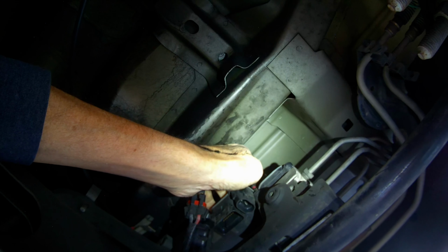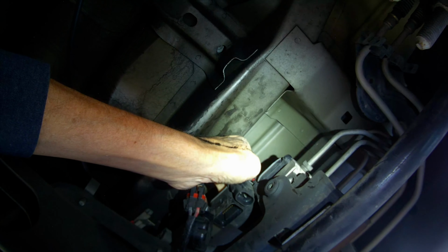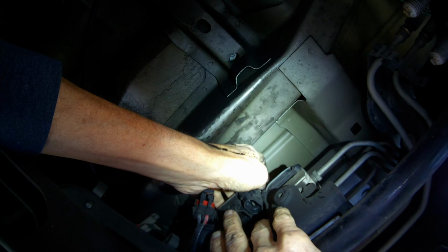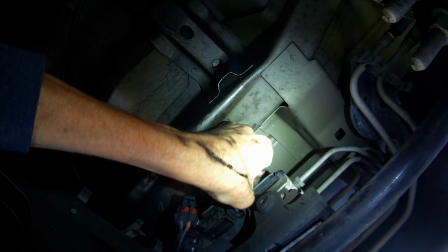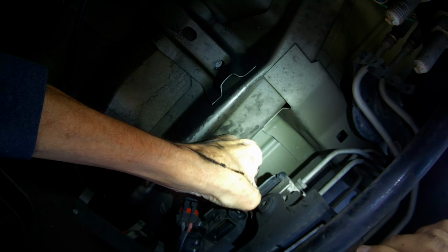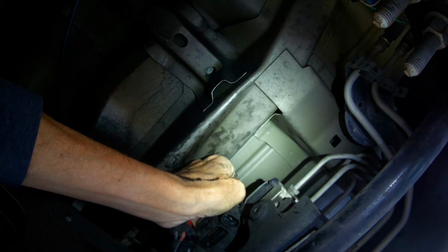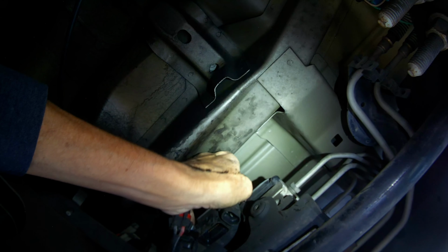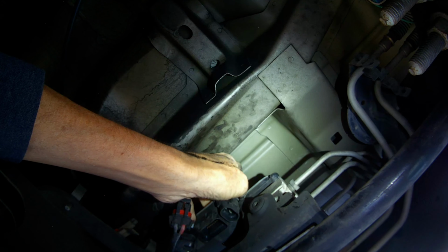And yeah, it's pretty common, when you get the intermittent light, that one of the solder connections in this ABS brake module is just loose, could even be more than one. It's just because this thing is connected without much dampening. So this 20-year-old vehicle, after all that time, this problem probably started to happen to us at about year 18. And we're just dealing with it now. It's been a couple of years.